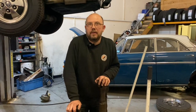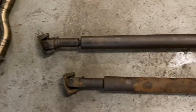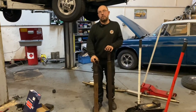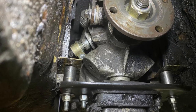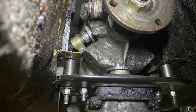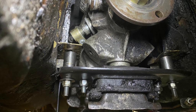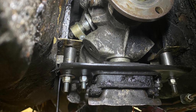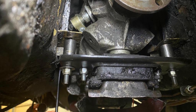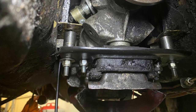For the mechanical aspect, nearly the last component is the prop shaft. The LT77 is longer than the P6 one so you need a shorter prop. Fortunately the shorter automatic prop is the perfect length for fitting a five-speed gearbox. Here we have a rear view of the installed gearbox. You'll note that to the left you've got the angle drive for the speedo gear which just about clears the sides of the transmission tunnel. We've trimmed away some of the reinforcing webbing and you can see the two bright shiny spacers - tubes we fabricated to account for the height difference between the P6 crossmember and the LT77 Triumph crossmember that we cut down and used.